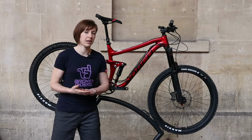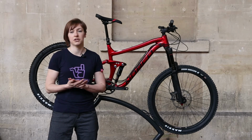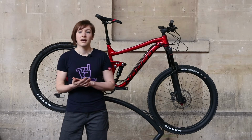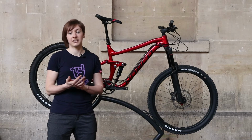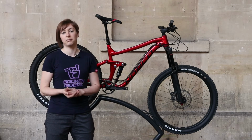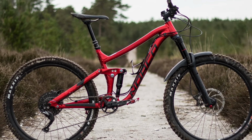And whilst the Range may feel comfortable to sit on, remember there's a 50mm stem up there covering up the short reach. The trends are right. It's more than just a fad, and a shorter stem would place the hands further behind the axle and provide more direct steering. The short nature of the long travel bike does allow it to be moved around the trail with relative ease though.